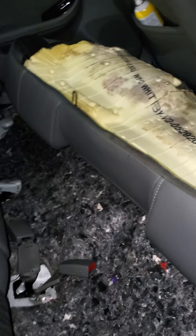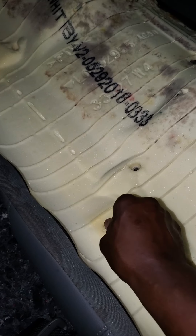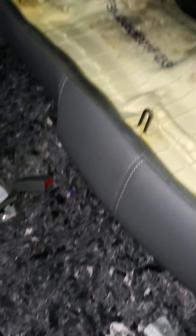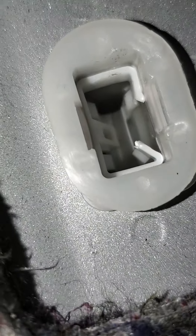I got the seat up to read under it. Not knowing how to pull it up properly, I broke the tab. I had to order new tabs — some were coming up $25 for two tabs. But it's easy — there's a little piece right here. To take the back seat out, you push it forward and it hooks right here. These are the front clips — they connect right here. If you pull that seat up without releasing the clip, it'll break and be flapping, so you don't want that.